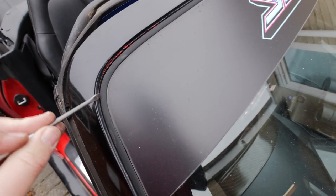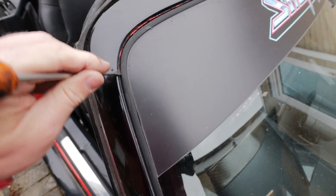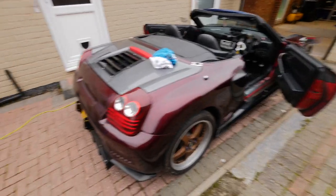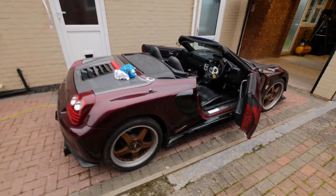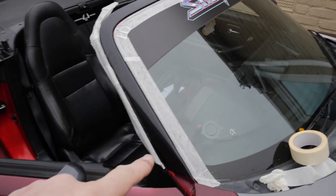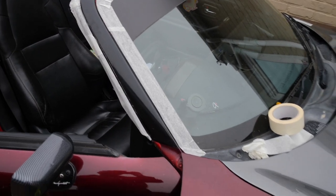If I get a screwdriver and just run it inside here you can see where all the black's coming off and it's letting the red out from underneath. So I need to get in there and sand that down better than I did last time, then get this painted a bit better and get it the same colour as the grey. My airline's not long enough to reach outside so I'm going to run an extension out - I've got this little mouse sander, we'll put a disc on there and use that to sand it down. I've put a bit of masking tape around it to protect the bits I don't want to sand.